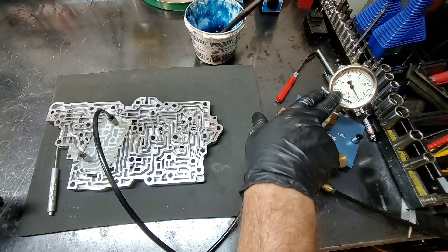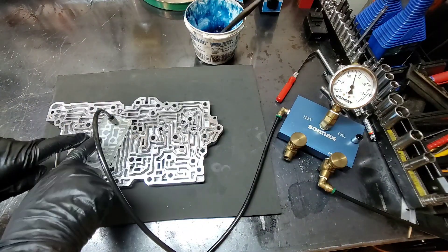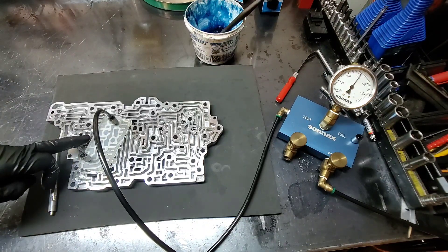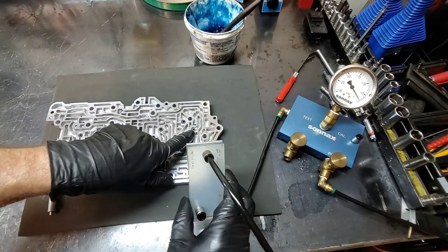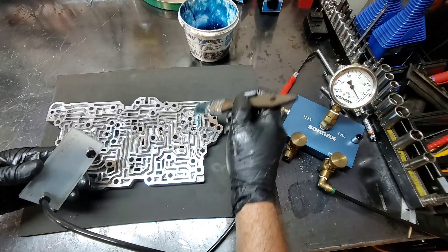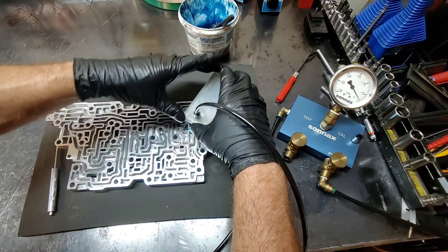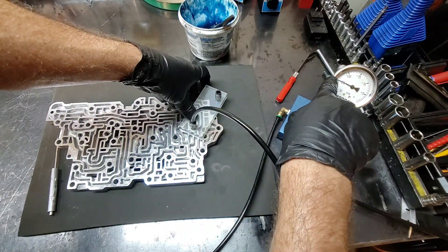There's nothing there because it's an open channel circuit, so I have to plug this. Keeping in mind I'm checking two at once — it's over 15, actually 16, 17 inches of mercury. I let go of this hole right here and it goes down to zero, like an opening right there. This is my best one so far — it's above 20, I know that for sure. That's what I tested it at a while ago. This one — the 1675 — had minor issues, but I'm still testing it.